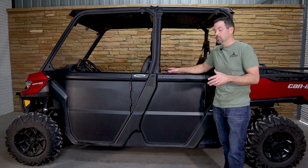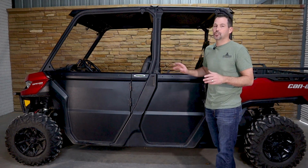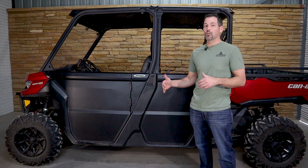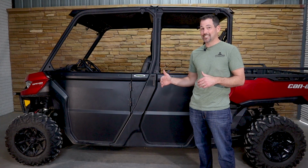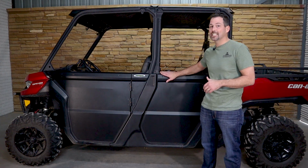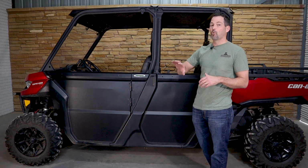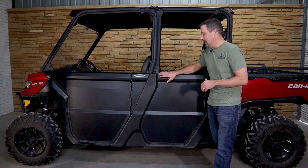Again, when you're adjusting the latch, make sure you get 2 clicks. It is a dual rotary latch, and it's just like when you shut your car door but you don't shut it all the way and it's kind of still wiggling. That's exactly the same automotive technology that we're using here, so it's important that you get that adjusted.